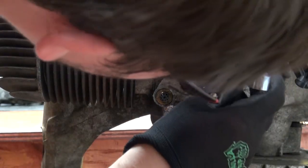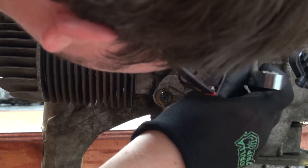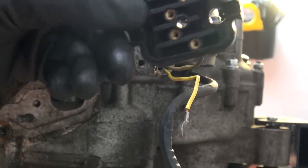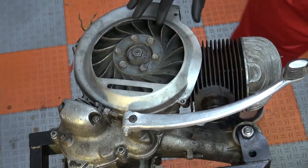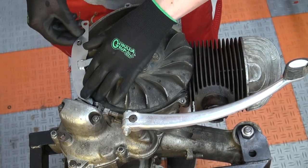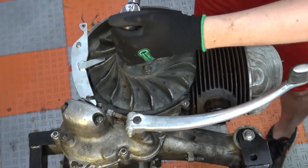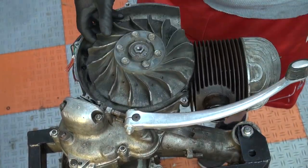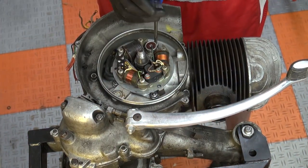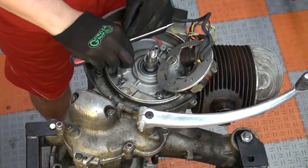In order to check if we need to repair the rotary, I took the chance to check with a feeler gauge the thickness of our rotary and everything seemed fine. Then we got the cables ready to take the ignition off. You mount your flywheel holder, unscrew your flywheel — and you don't need a special tool because the nut on the rally is held with a circlip so it pulls off by itself.